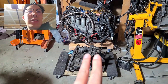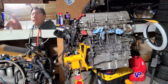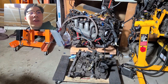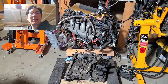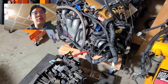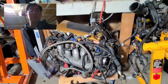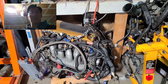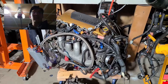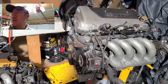I finally got the transmission separated from the motor. We're going to have to remove the clutch and inspect it, and then do all the gaskets on the new motor — the valve cover gasket, the coil plugs — and I'm going to change the lift bolts. We do have that little leak by the head gasket; there was always a leak in that general area but I had no idea where it was coming from. I kept doing UV dye tests and messaging people online, but no one could tell. I think maybe the head stud wasn't tight enough, causing separation when lifting the motor.